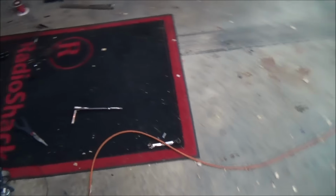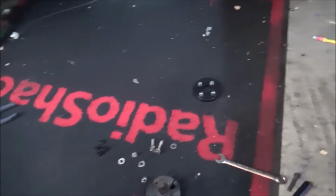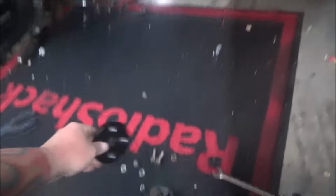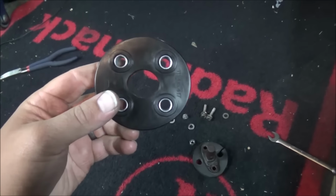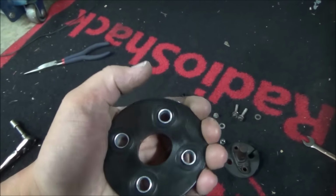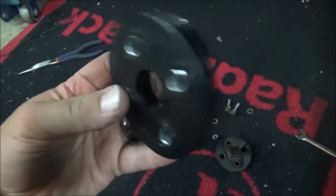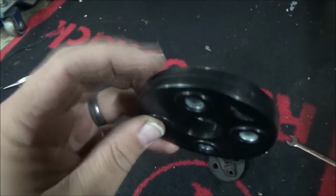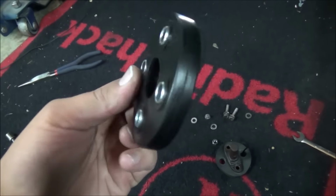After fighting this horn wiring for hours and hours and redoing everything 100,000 times, I figured out that the problem is this piece of junk steering coupler that I got from CIP1. It conducts electricity. Apparently it's got graphite in the mix. And it conducts electricity, so the horn always sounds.